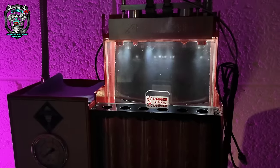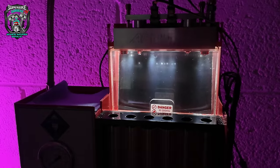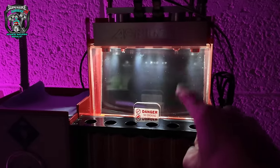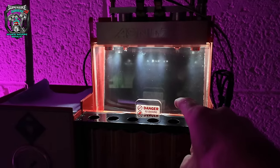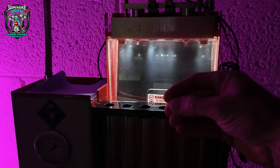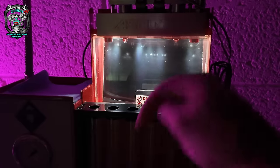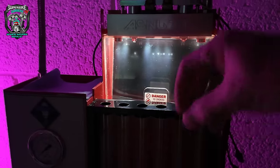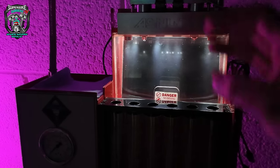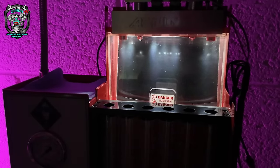The issue is they're discontinued and not available - they've apparently stopped manufacturing them. The way these injectors fit into the throttle body, the fuel is literally getting sprayed onto the inside of the inlet manifold. They're single hole injectors, so I'm not expecting a massive atomization pattern, but I am expecting some. Stand by - I'll get more information and report back.